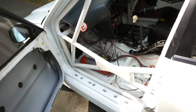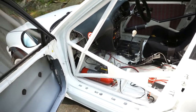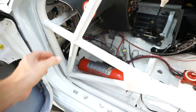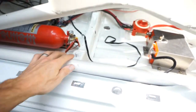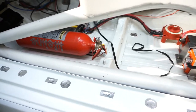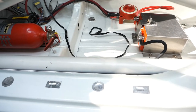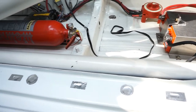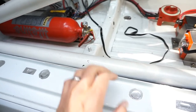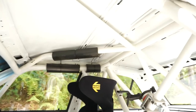Let's take a peek inside. This is the new cage — it basically rests on all the same spots the old cage did in the chassis. The new cage is a bit more extensive; it's got this sill bar, which is a requirement now for New England hill climb — and it should be a requirement everywhere. Unlike track, on a hill climb if you slide off the road you could hit a stump or a tree and get real intrusion from below.